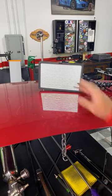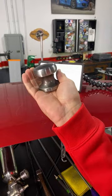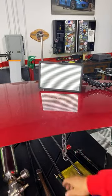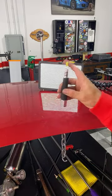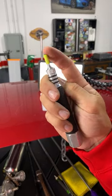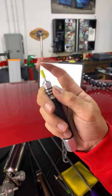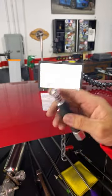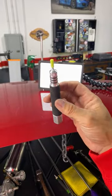Recap. So I put another dent in there prior. It was basically just showing you how we use this dolly in the common purposes of those types of dents. And then what we were doing is using the Galaxy with the Guardian tips, right? Because here's a cover for it. It makes the tip less invasive when you're tapping with a VIP or this type of tip, because it's metal, or this one's aluminum under here. Basically you can tap down without worrying about marking the paint. Okay, so that's the purpose of that.